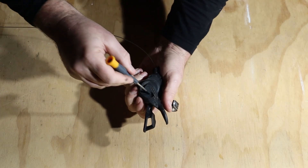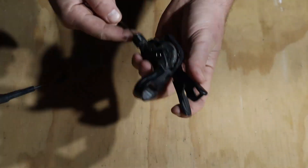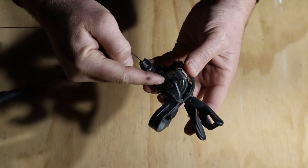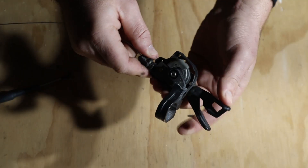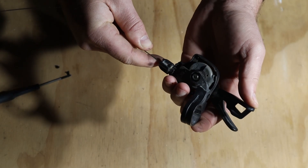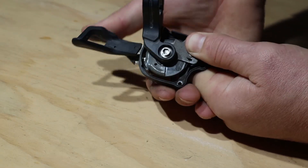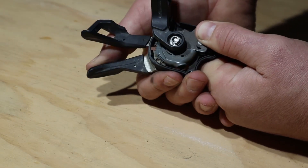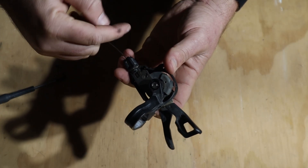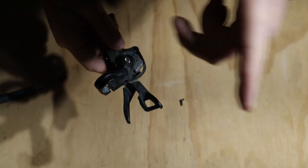Let me show you how I did it. Let's open this up quick and have a look. Pretty much how every shifter works is that there's a barrel inside that turns and pulls the cable just a little bit each time you click. Each time you do that, the cable then pulls your derailleur up to that next set of gears. So all we have to figure out is how much each shifter moves, and then make a little converter that translates this one to the new derailleur. Easy.